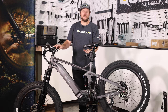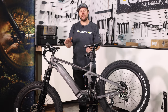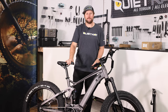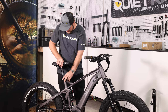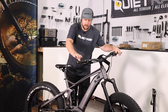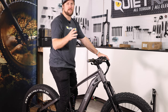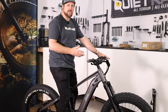Now we've got the bike all put together. We're going to go ahead and drop it down from the stand onto the ground and make our final adjustments — fine tune everything, make sure everything's tight, and then we'll be ready to ride. Now we have the bike on the ground, which makes it a lot easier to do our final adjustments. The first thing I like to do is set the saddle height. An easy way to do this is to stand next to the bike, locate the top of your hips, and adjust the saddle so that the top of the saddle is right about at the top of your hips. Another good way is to put your leg over the bike, sit on the saddle, and make sure you can touch the ground with your toes — or if you're more comfortable, you can make sure you can touch flat-footed. We don't necessarily need the saddle height to be perfect like on a traditional road bike because we have the motor to assist our pedaling.